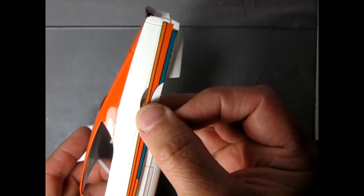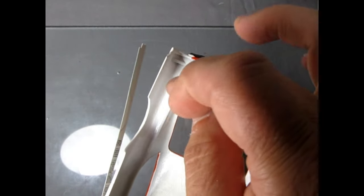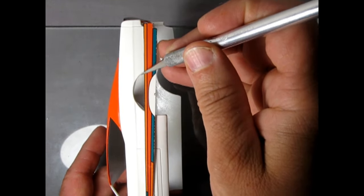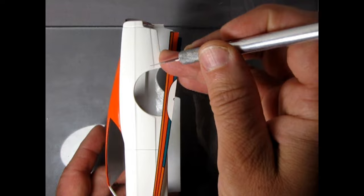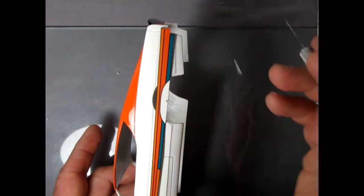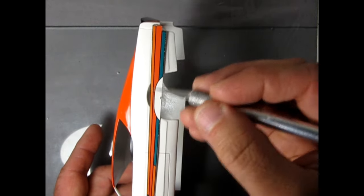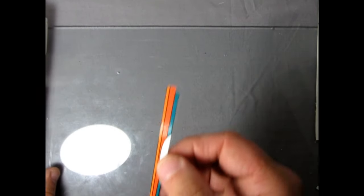And then what I would do is, because the decal is wet, I could wrap that portion around up into the wheel arch opening back in here. And then that way, if I cut that curve and I accidentally cut it a bit short, you're going to see a paint line up and around that edge right there, because I cut it back a little too far. So, if you want the continuous color to come through, you could just cut it back sort of there and then wrap that edge around. Or leave the little white part if you cut it too short. So that's sort of the escape route.